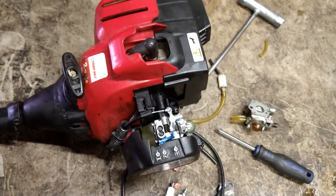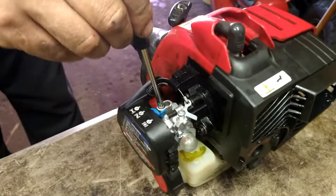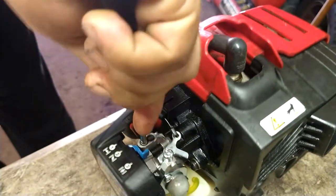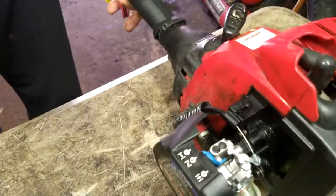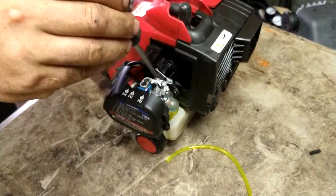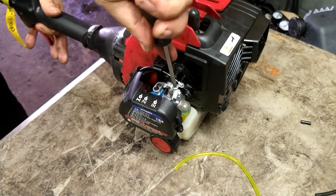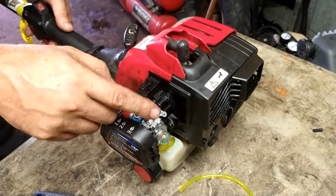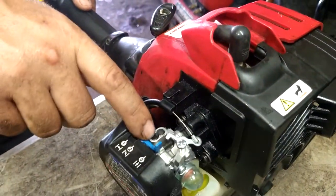So let me go ahead and show you guys. I'll start it off and I'll show you counterclockwise what it sounds like and then clockwise what it sounds like. Now we're going to work with the idle screw and make it idle — this one right here. So you're seeing it's not idling down when I'm turning this down. That means this one here needs to be adjusted just slightly counterclockwise to bring the idle down. But once you do that, you're going to have to readjust this one again.